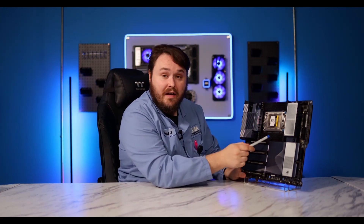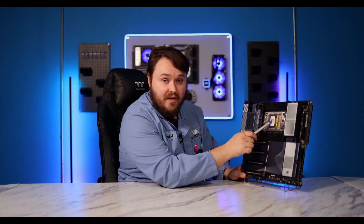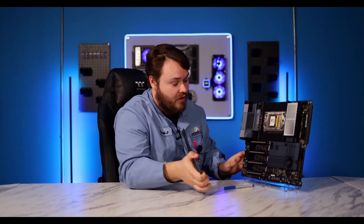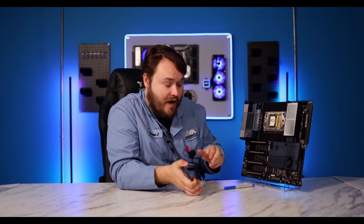Going over the center of the board, we have your eight DIMM slots, which take DDR5 R-DIMMs. You have your SP5 socket for your CPU, four PCIe Gen 5 full 16x slots, all of your Gen 5 M.2s, and your BIOS battery.